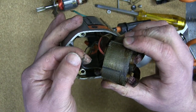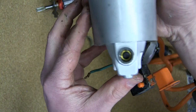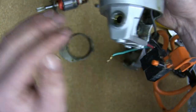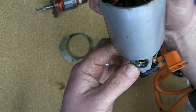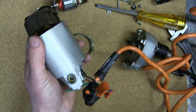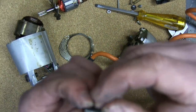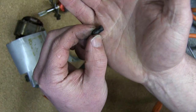Here's the arrangement for getting the electricity into the brushes, well, the brush holders. Nice brass brush holders, but look at that. They're round. So there's nothing to prevent the brush from rotating other than the curvature worn in on the commutator bars. That's interesting. There's lots of oil in there too. Can't be good. It doesn't want to, oh. Oh, look at that. Strange brush arrangement. Perfectly round.